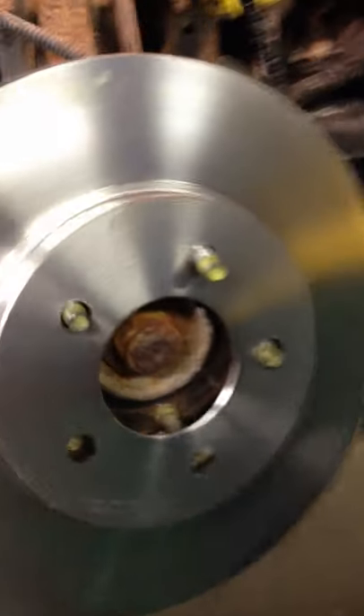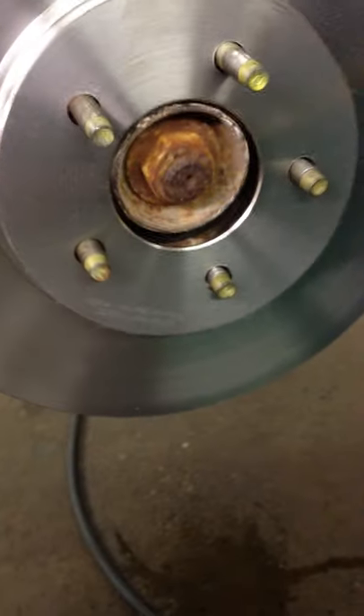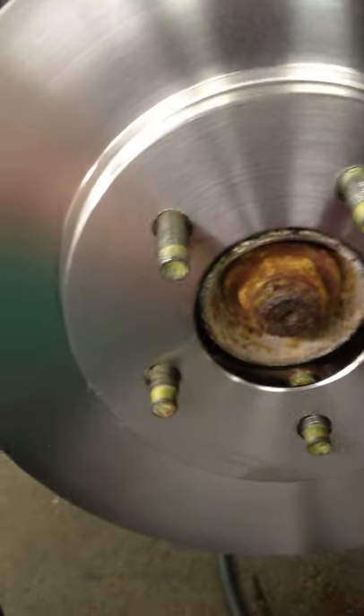The new rotor — I always see it just falls on. Push it on like that or it'll kick out at the bottom. These are Motorcraft ones — they don't have any oil on them, I don't even clean them; they're perfect from the factory. If you get anything aftermarket, they do have oil on them to prevent rust while stored, so you're going to want to hit them with brake clean front and back and then wipe them down.